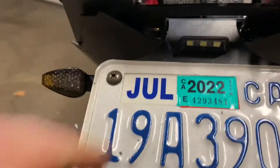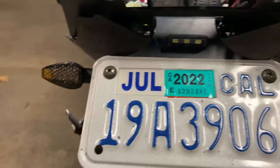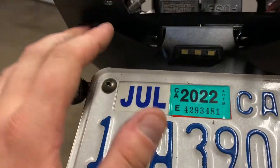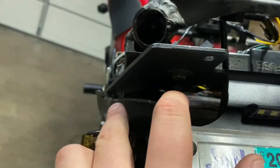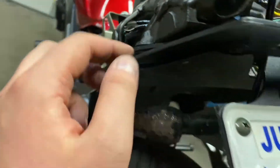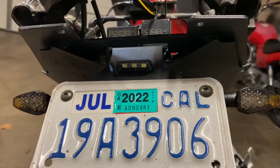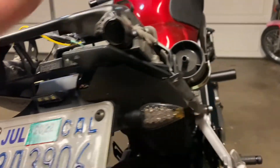After wiring, I used the original plugs — I cut the cables off the old turn signals and used the original plugs to wire in the new turn signals and the new plate light. I bolted the mount on first using the original bolts — it fits perfectly. Then you sandwich in the second plate with the spiky points facing toward the front of the bike. The main plate holder and the little beauty cover plate are both bolted by those two bolts at the top. You just literally screw it on with the 10mm.